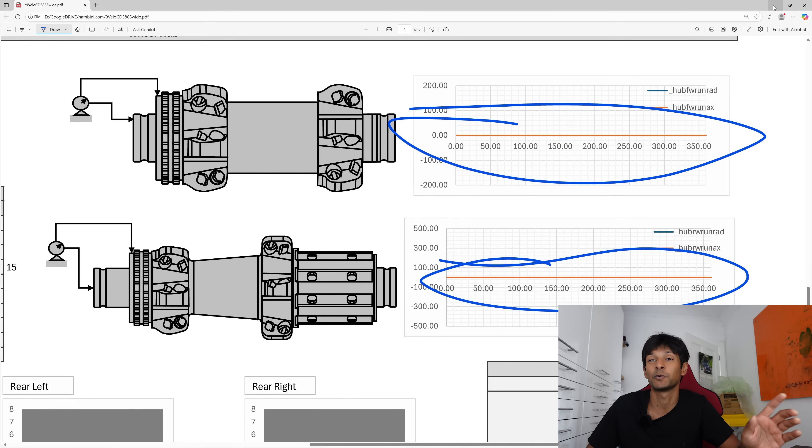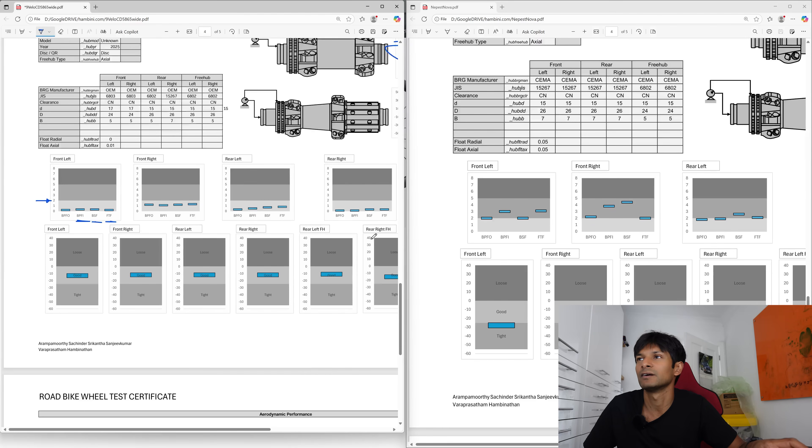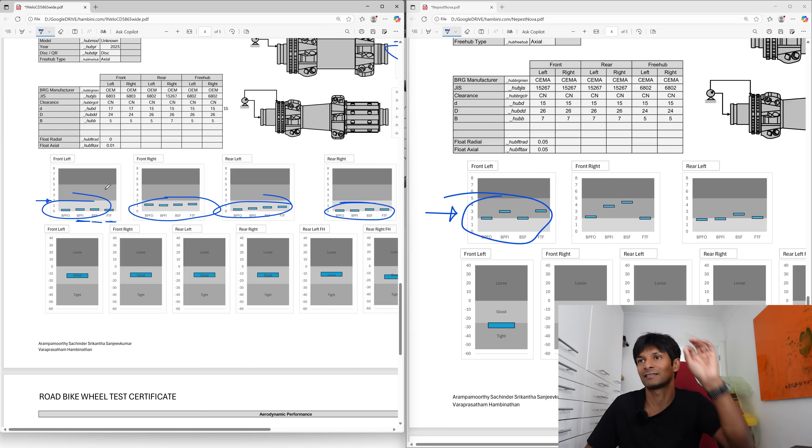If I were to compare the 9velo wheel to a decent wheel — say the Nipas Nova or the Nipas Maui, which is pretty good — you can see the difference. The competitor is a bit higher, and you'd say that was good — and to be clear, it is quite good. But on the 9velo all of these metrics are just exceptional. I'm measuring to 0.01 of a millimetre and getting zeros, whereas it looks like 9velo is going to single-digit microns. Can't really say more than that.